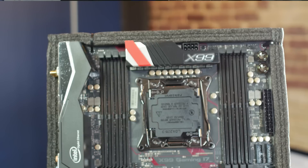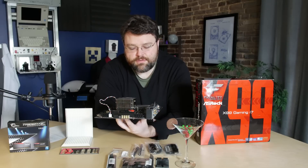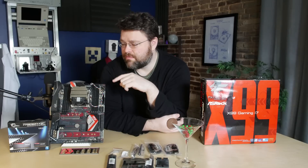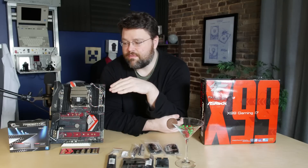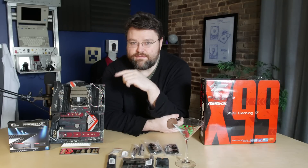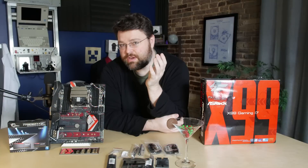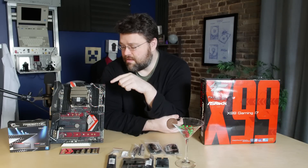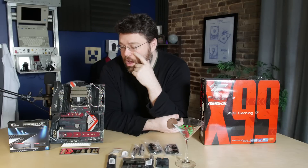At the top of the board, there's a heatsink. There are two more fan headers just below the CPU — one turned horizontally and one vertically — depending on whether you want a push-pull configuration or front panel cooling. Just below the RAM slots there are two more SATA connections, so this motherboard has ample SATA connections. Let's get nerdy for a second and talk about the power delivery system. It's 12 phases — an ISL 6379 6-plus-1 true phase PWM driver, using ISL 6611A phase doublers, giving you 12 phases for the CPU. There are also two separate phases providing power to the RAM.